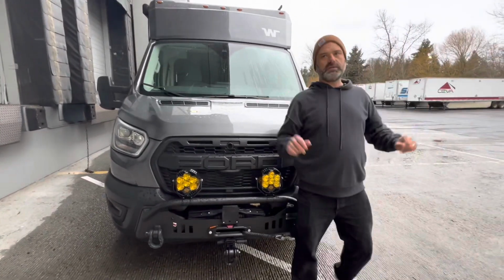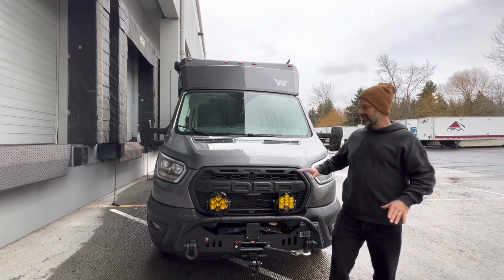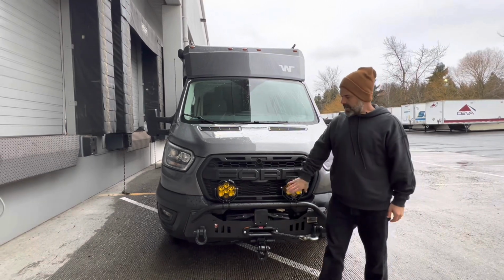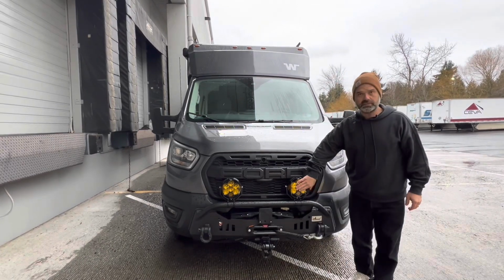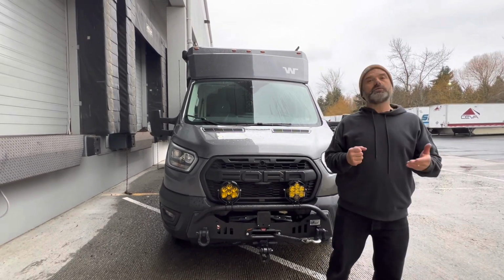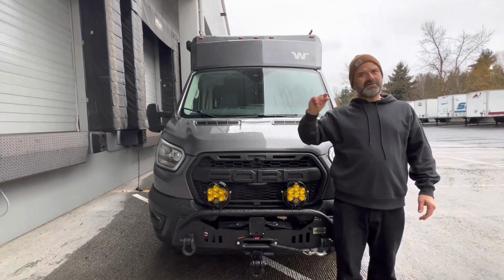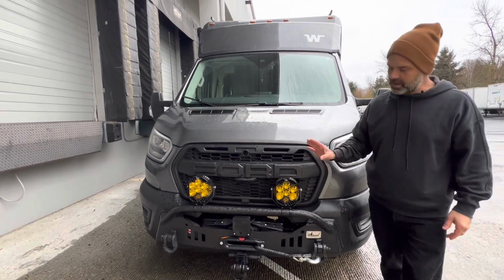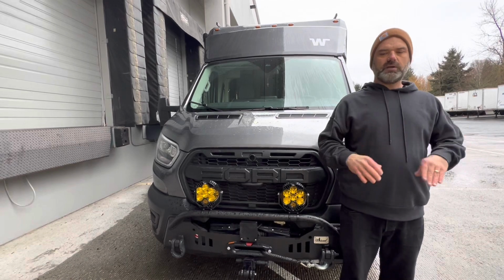So as you're driving down the road, and let's say you're in some conditions where it's gotten a little bit foggy, there's some snow, there's some dust, conditions that speak more to what we're going to call Zone 3's needs, that amber lens is actually going to cut through those conditions more effectively. If you had a white light, or a clear lens I should say, in perfect conditions where you're not getting the dust, the clouds, the fog, the snow, that direct beam is maybe going to give you a greater distance, but it's not going to be significantly greater. Again, we're talking equal lumens, and in a moment we're going to talk a little bit about lumens, but definitely consider that when you're purchasing a set: where are you going to be, what are you doing, and what's the overall objective.